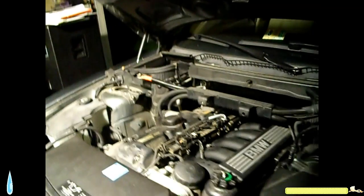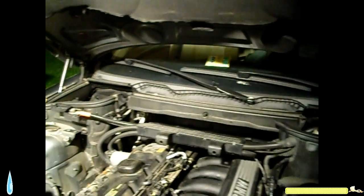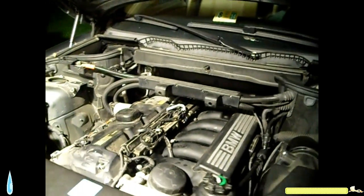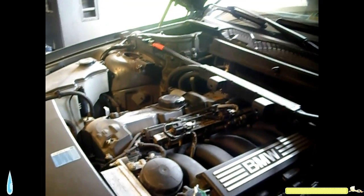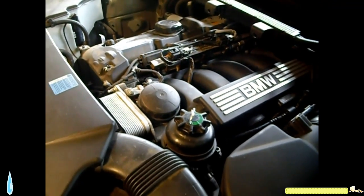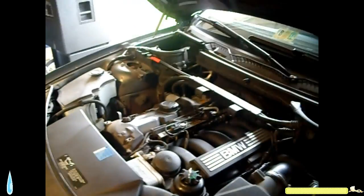We ended up with a fuel leak on the second nozzle from the front. So I gotta get the fuel manifold off and find out what's going on there. I gotta replace some O-rings or something. We developed a leak on the number 2 fuel injector from the front, so now we're gonna disassemble the fuel rail from the injectors again and see if we can fix it.